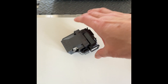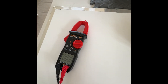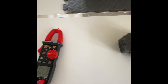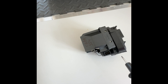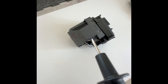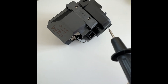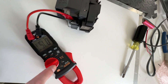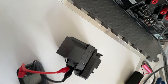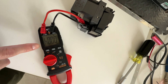To test the lamp, one thing we can do is use a digital multimeter to measure the resistance of the lamp — the two pins of the lamp. A good lamp is supposed to be open circuit because it requires a pulse voltage to excite the gas inside. So one way to tell is to measure the resistance with a multimeter. I'm clamping it — the contact's not very good — but you can see it's very much a short circuit.